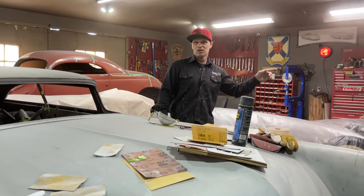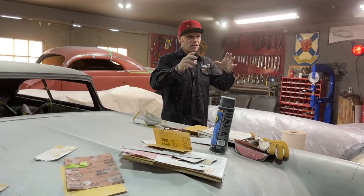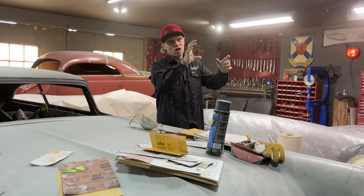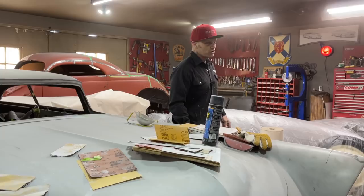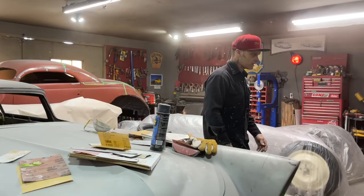What happened is I welded the cage back together. The motor is still rocking in it. I took a piece of angle iron and put it on the bottom of the electric motor and screwed this side, screwed this side. So the thing is just rocking on top of this piece of angle iron going across. We're just doing what we have to do before we get a new fan. With the weather that we're having, I don't want to go out there and change it, and it's probably not the time to go get one. So we're working in a pickle, but we're doing the best we can.